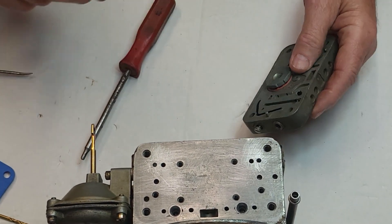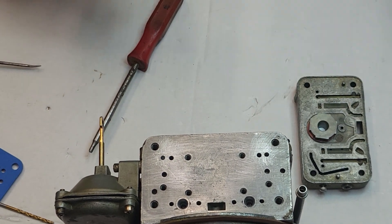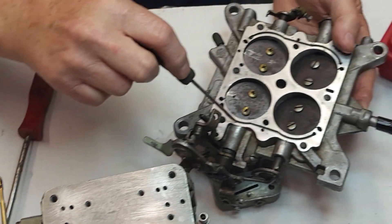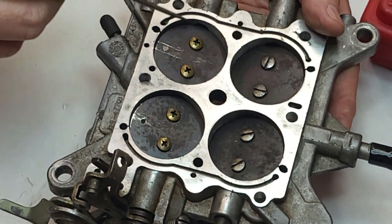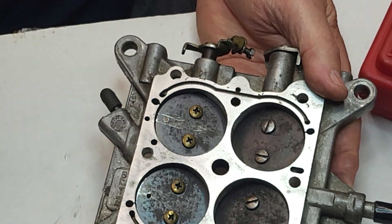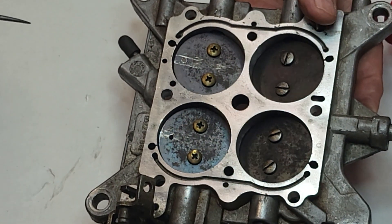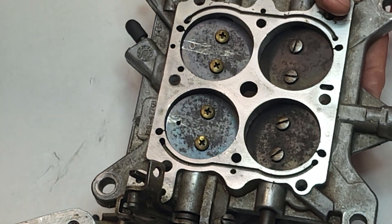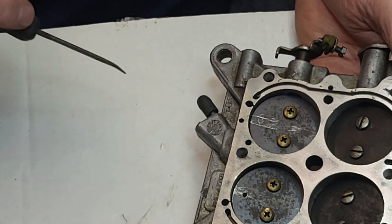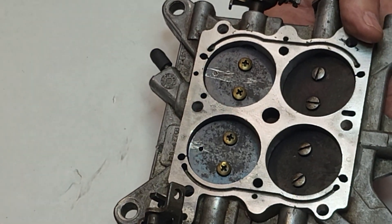When we get past this point, I'm going to have to show you a few more things we're going to have to do — like on the throttle body, there are some mods we're going to have to do. While we're epoxying this side here on the main body, we're going to epoxy right in here on each side. This is coming from the front to the rear on the idle circuit. If you don't block it anywhere in here so it can't go back and forth, you'll never have a separate four-corner idle circuit — it'd be pulling fuel from front to back and back to front. You can't control it with your adjustments. They usually put a little peg in here from the factory on the older double pumpers that had four corners, but the epoxy works fine.